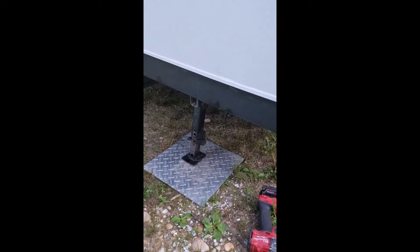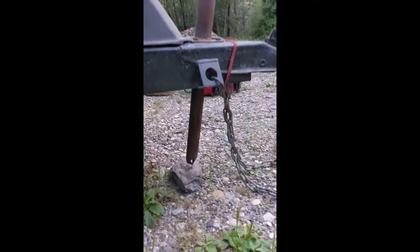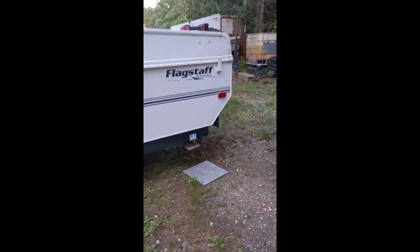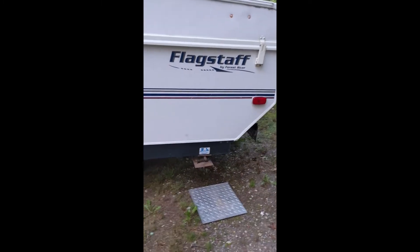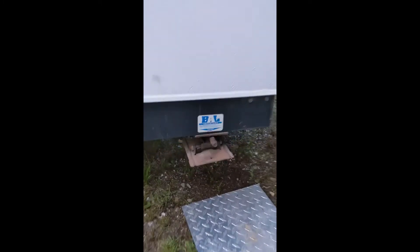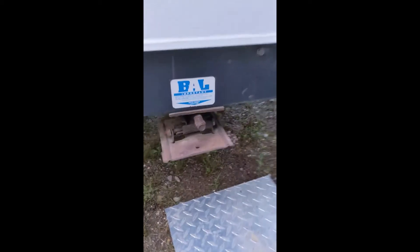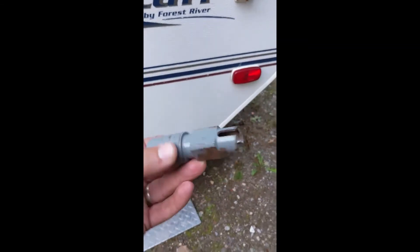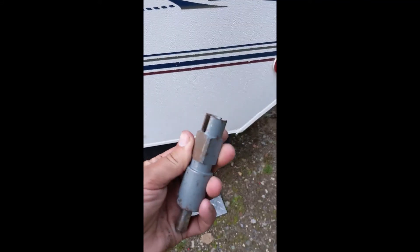The weight is well and truly down now on these front two feet on the sides — you can see that because the tongue jack pole is floating. Look at the front: so stable. But if you pan to the back, we've got nothing supporting the back, and we don't want it tipping back when it's time for bed. So we're going to use these jacks — on the left and the right — down onto that plate. Let me position the plate. Here's the tool I'm going to use: these notches slide onto the adjustable part of the jack, and that little bit threads right into my drill.